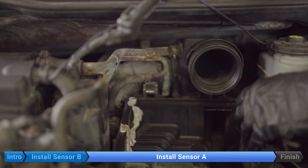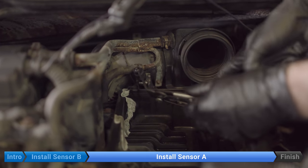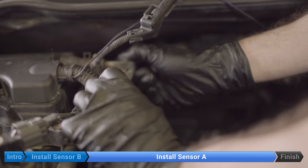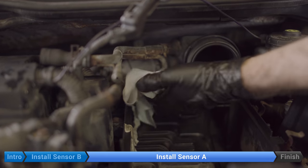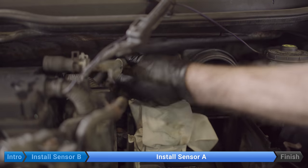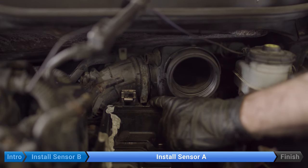One little caution: if this is an older car and there's been a lot of salt exposure, it can be extremely rusty right around here and this coolant pipe might crack off in your hand. We'll remove the hose clamps first. Now we can just pull these hoses off — if they're stuck, just kind of twist them a little bit and pull them off. If the engine has been running recently, be careful — this coolant might be a little bit warm. Now we've got a bit of room to wiggle, so we'll pull it out and set it aside. Now we're going to loosen this hose clamp; you can use a six millimeter socket or a Phillips head screwdriver.